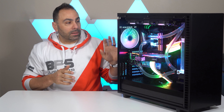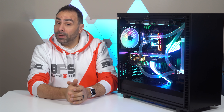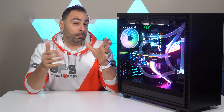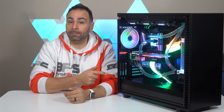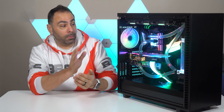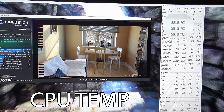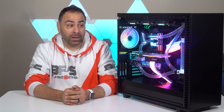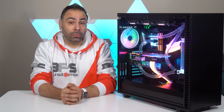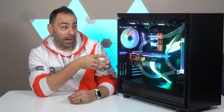What I wanted to see was what kind of temperatures we got when the system was under full stress. That meant I was looping Cinebench and looping Unigine Heaven. With both of those tests running for 20 to 25 minutes or so, I pulled up HWInfo64 and started monitoring the temperatures of the CPU and the GPU — because remember, this is a full custom loop and both of them are involved in our water cooling setup. Looping Cinebench over and over is one of the worst things that you can do for your CPU as far as thermals go, and that's going to really skyrocket your temps very quickly. And doing that while also stressing the GPU through Unigine Heaven meant we should see the worst thermal situation we could possibly have here.